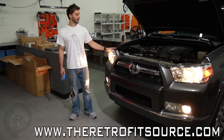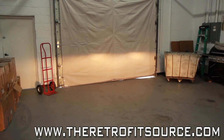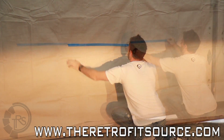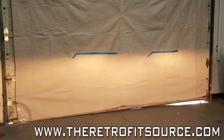To do that, we're going to aim the car's headlights on a wall at least 25 feet away, like we have here in our shop. You can see the height of the beam pattern, and you can also sort of make out the actual steps in between. So what I'm going to do, I'm going to go ahead and mark that with our masking tape, and when we go to put on the new headlights later, it'll definitely come in handy.